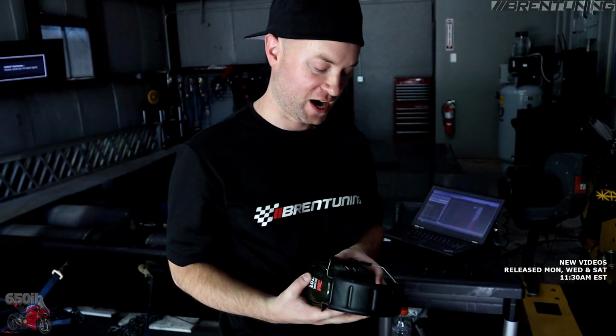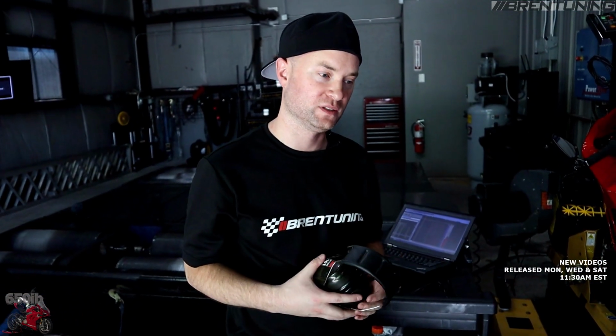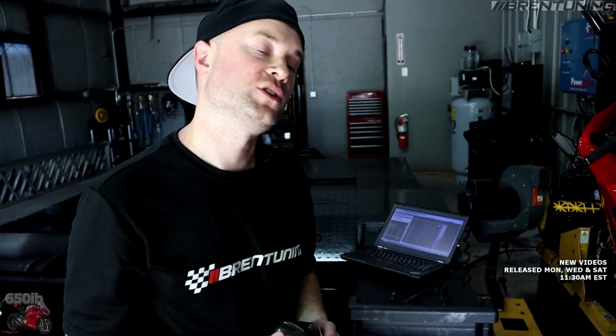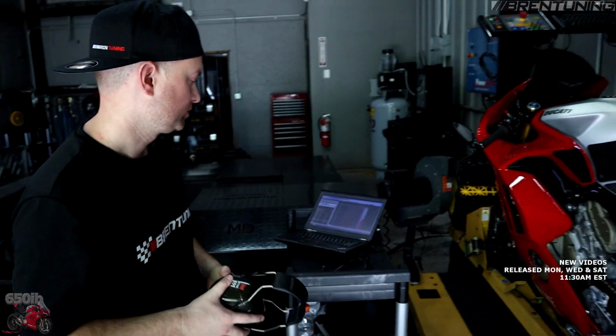So yes, we've had some test dummies, some wild, I don't care, Kamikaze type guys. Kamikaze customers. And we found so far so good. The really best way to do it is to put an oil pressure gauge on the motor, see what it's doing in those lower gears. But we've made gentle changes over the years and we're confident so far that what we've seen works. So we're going to apply what we know is safe to this bike and go from there.